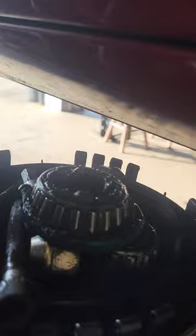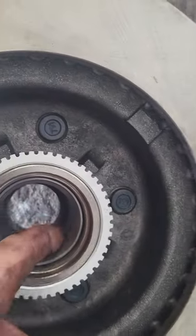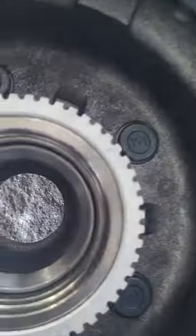This is why they didn't do the job right — because if you had to take the inner bearing out, then you'd be able to clean all that crap out and fix it right. So now that this hub is completely clean, I'm gonna pack this cavity with wheel bearing grease and then finish up this job.